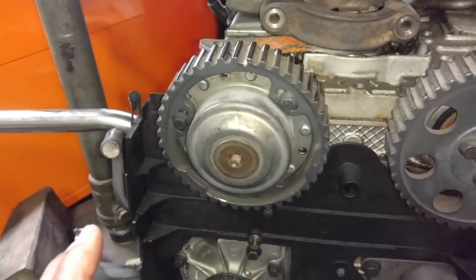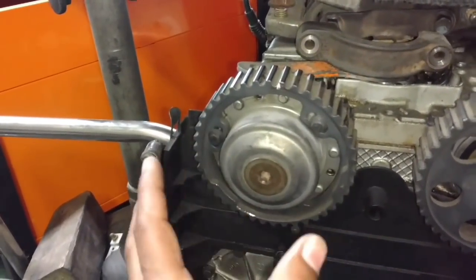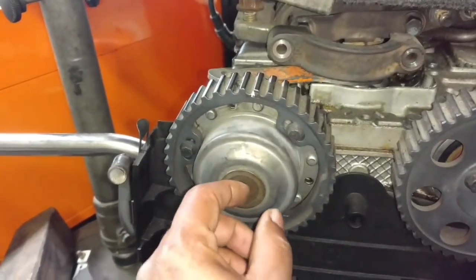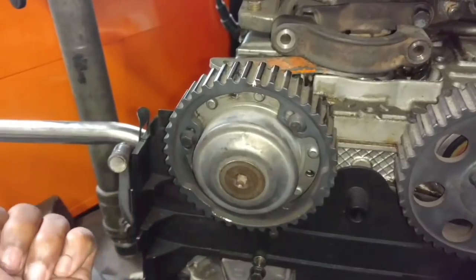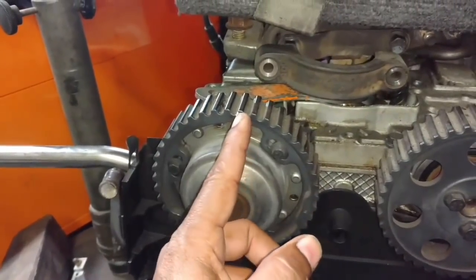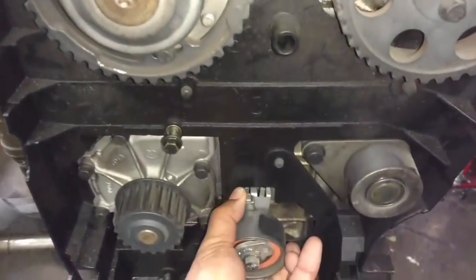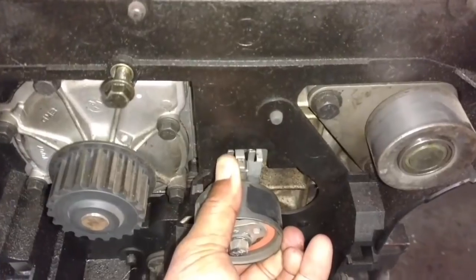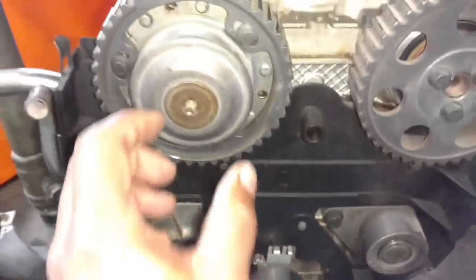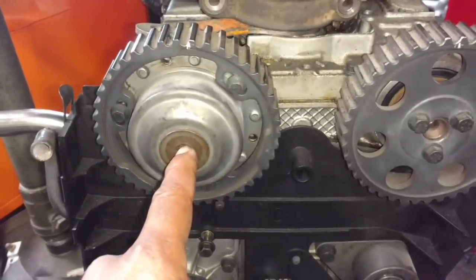These earlier hubs will likely spring load back a couple of teeth — that's okay. Let it spring load back. Then you install your belt. When you go to put your belt on, you want to take your cap, turn your cap in, and turn your tool clockwise to crank the tension and turn this hub clockwise so that it's back on its mark with the cover. Then slip your belt on. After you've got your belt on and tensioned right — with your tensioner approximately at 70 degrees, 90 degrees, or 35 degrees — then you pull the cap back out. With your cam locking tool still on the back, you torque that center bolt down at its proper torque.